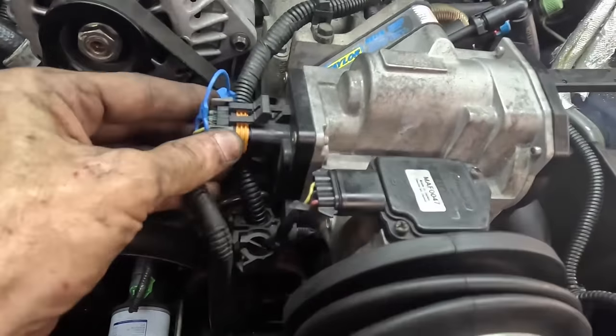Anyway, cooling system cleaner's in there. There is no coolant. I did adjust the oil level. There's the bucket right over there with oil in it, if you want me to prove it. That's been done. I'm gonna back it out, refill this with water. We're gonna let it run. I'm gonna leave the funnel on there so it doesn't build pressure. That way it does not present a danger to me when I go to open the system back up, because it will not be pressurized.